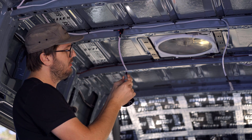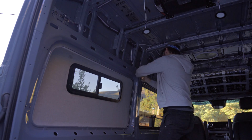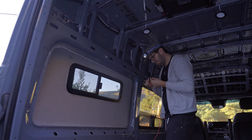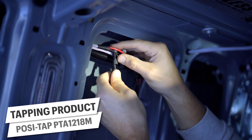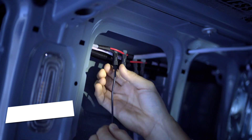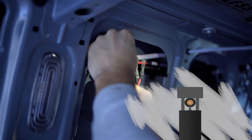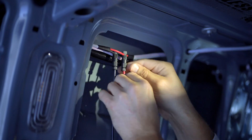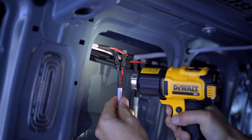I went ahead and cut down the leads a little bit. There was a sticker on the black wire designating it as positive 12-volt DC. Of course, we are using the DT connectors again. There are numbers on the side of these and for the entirety of our van build, pin number one is positive and pin number two is negative. For crimping, I found the solid contact version of these connectors works best, and this cheap $22 Amazon crimper has been the star of the show. If you're interested in more details on how we assemble these connectors, check out the YouTube short we recently put together. Once there's a plug on each end, the light clicks into place. Here I'm running the cable down to the electrical cabinet from the main wire. I do a mock with a single lead to get an approximate length and then add about a foot or so for insurance. You can't make a cut wire longer, but you can most certainly shorten it up.